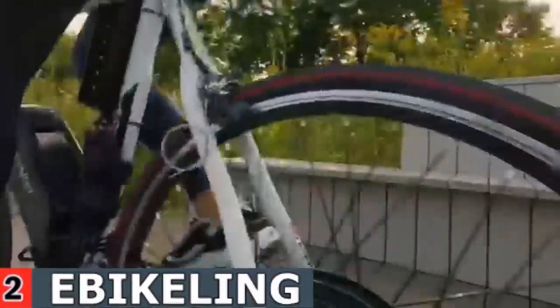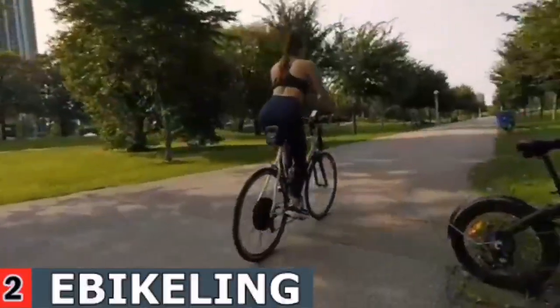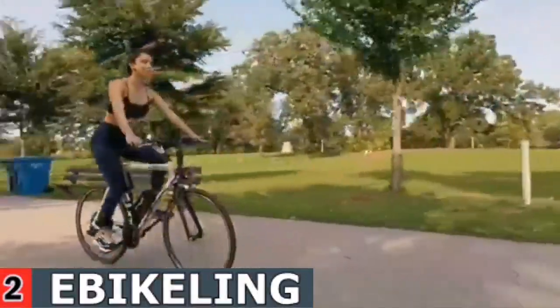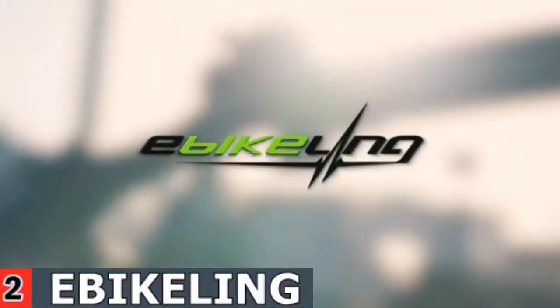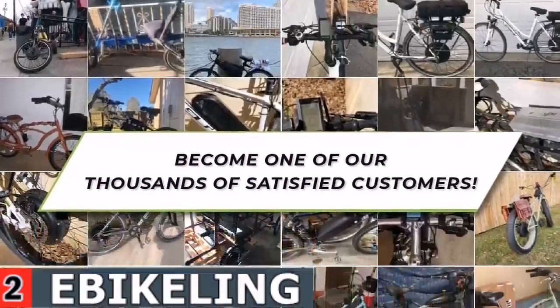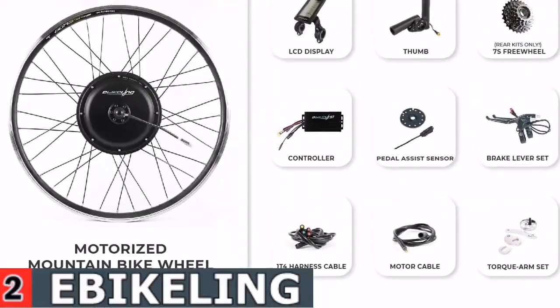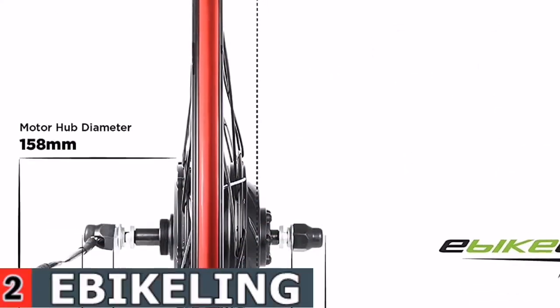The aluminum double-walled rim and hub motor are already attached in the box. Kits are ready to install right out of the box. All you need to do is replace them with the original tire. The wheel axle diameter is 10 mm. Steel forks can be filed if the axle does not fit into the dropout because of its slightly larger diameter. Please do not file more than necessary and make sure that it does not damage the forks. Aluminum forks can also be filed with extra caution.